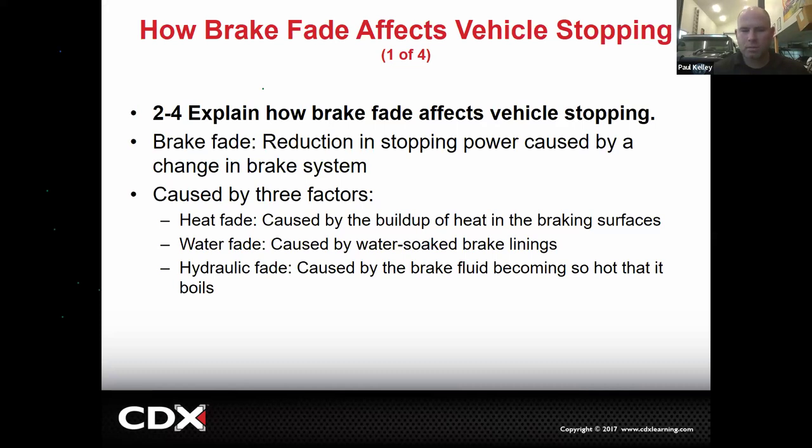Sometimes I ride my front brakes because my brakes on my bike are not really designed to be wet, and they actually get water fade. So like if I'm cruising on the freeway for almost an hour and I get ready to go to Valley View and somebody cuts me off and I grab a handful of front brakes, it doesn't really stop. So by the time I know I'm going to use the brakes, I'll start riding them. Or if traffic gets kind of squirrely, I'll start riding them. And what'll happen is they'll get hot enough to boil the water out of them and dry them up. And I'll be like, all right, cool, I got brakes again. So like, this is for sure a real thing. You just don't really notice it on cars. But maybe a little bit if it were drums.